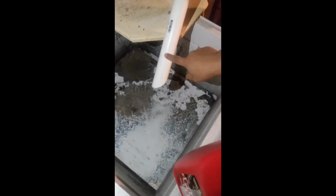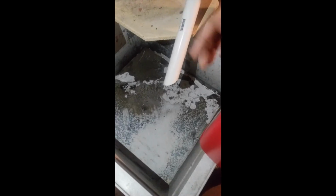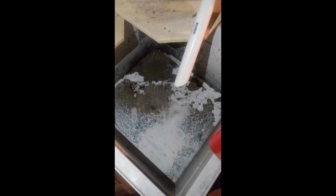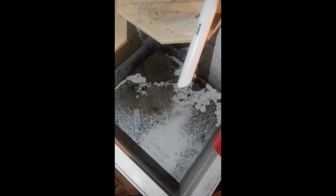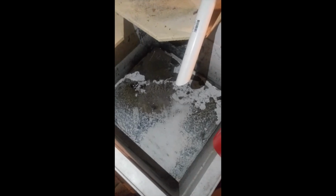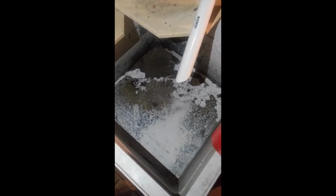So what I'm going to do is let that sit down in the drain, and then have the washing machine run a cycle with the baking soda on the hottest and longest cycle, and that water will drain into this pipe here, and all that hot water will flush out the Max Drain liquid, and any clogs from lint or whatever. Hopefully that will dissolve some of that and make sure that the smell that comes whenever there's a backup gets flushed out. And then after I do the baking soda rinse, I'm going to do another cycle with vinegar and do the same thing and just see what happens. This is an experiment. I'm testing to see what happens.